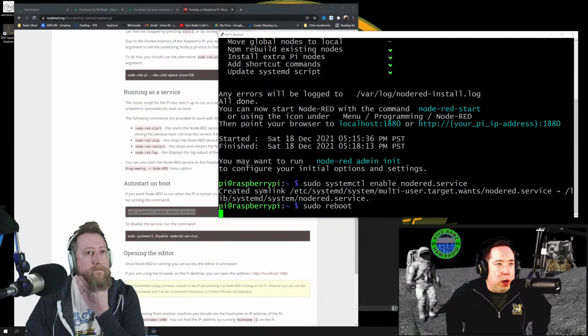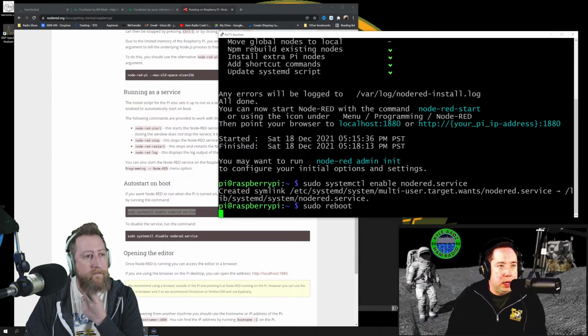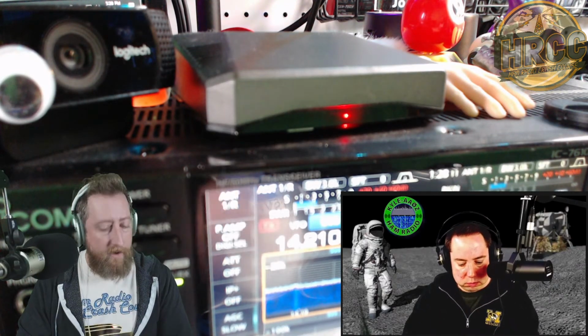All right. So whenever that Raspberry Pi comes back up, we're going to go to the IP address. We're going to bring up a web page. There's my Pi. So it's rebooting right now. It's doing its thing. So now we're going to bring up a web page, you said. So this is web-based. So we're going to use a website to get onto my Raspberry Pi. Correct. So that is going to be the interface that we use. And so we're going to go to the Pi IP, and this runs on port 1880.